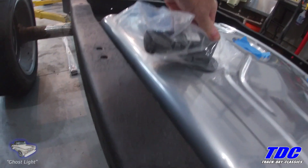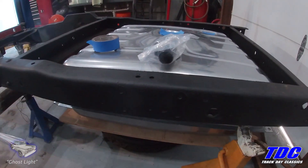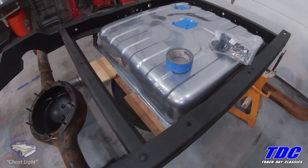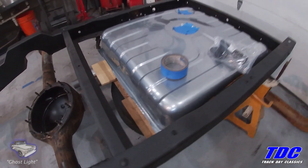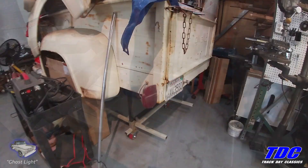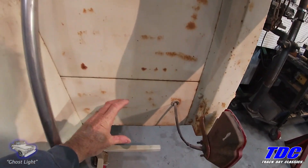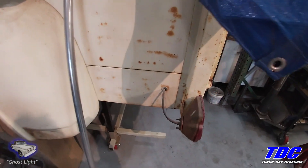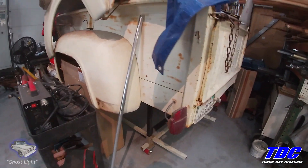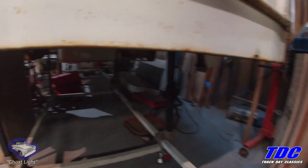It also has this sideways-facing intake pipe. Rather than bring it up through the floor, I thought the best thing to do would be to bring it out the side. I'm probably going to have to cut away a little bit of my frame just for a little extra room so the tank can go up and down, and make this serviceable so it comes out — I have to build some kind of bracket that bolts in from the bottom. I'd like to have the fuel cap come right out about here, maybe even turned up a little bit with the cap on it, old style.